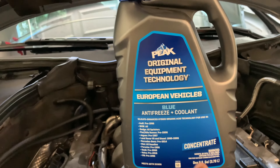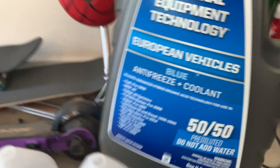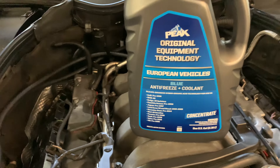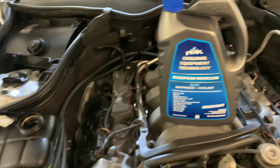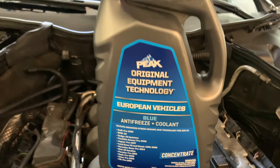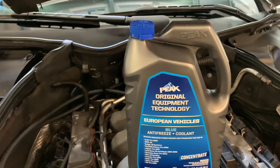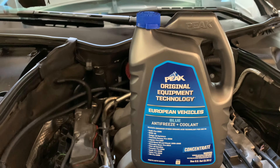When you do this job, you're going to need concentrated coolant. I picked this up today. I do have some 50/50 pre-mixed — I've had these for a while, but I completely forgot I would need concentrated for this kind of flush. When you do a complete flush, you need concentrated. I'm going to go ahead and put the 50/50 in. Since I know there's still distilled water in the system, I'll use about a quarter of this concentrated bottle to make up for the distilled water remaining. I have two bottles — I'll use those and pre-dilute any remainder before adding it to the system.